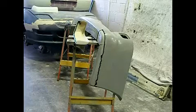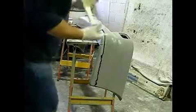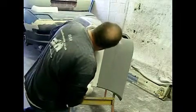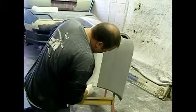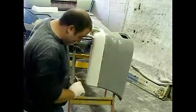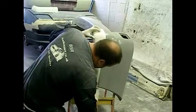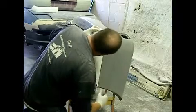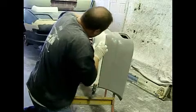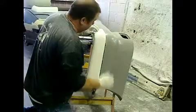As you can see, I've put my line of sealer on the bumper and on the spat. So what I'm going to do now is stick this back on here. I'm going to follow my line as best I can. That's good. Now I'm just using a plastic clamp. It's a good idea to have a pair of gloves on when doing this, because this stuff does go everywhere. Right, okay. If we clamp on the bottom, that's held that lovely. Just going to push that in. As I say, I'm not worried if it oozes over the top, because I can trim that back later. That's not a problem. Okay, that's good.